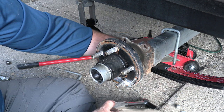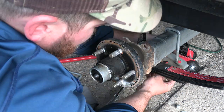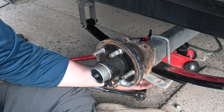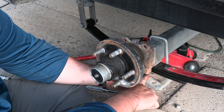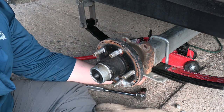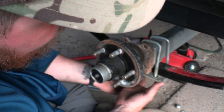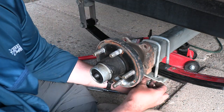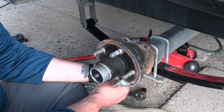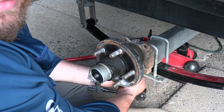I'm going to keep this one corner on and back this nut all the way off to the very base of the thread. There's a little circle in the middle — you can kind of see it right there. That's a nut for the leaf springs, it goes right there. So what I'm going to do now is just put this one on and hand tighten all of these little bolts. When you go to tighten these, you're going to want to tighten them a little bit each so that they get tightened evenly.